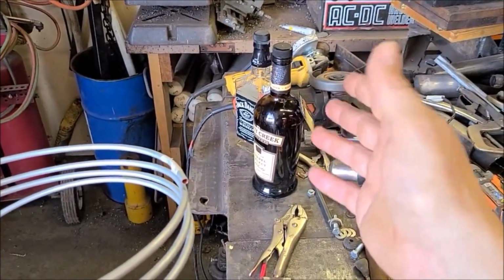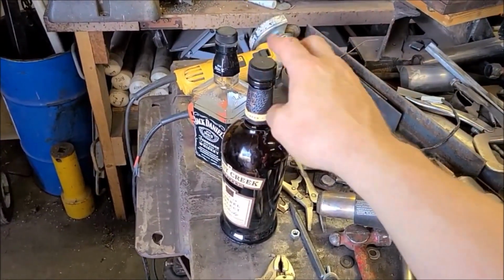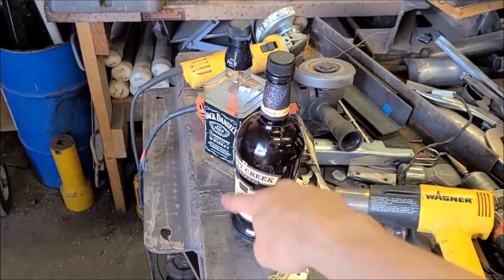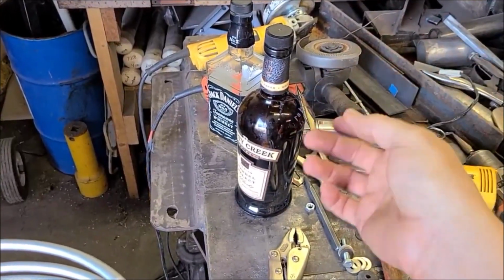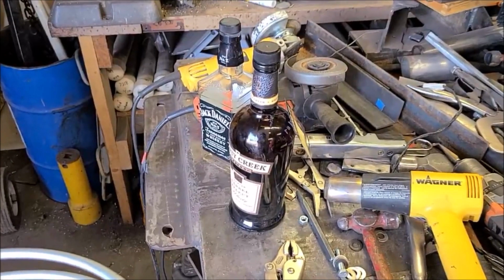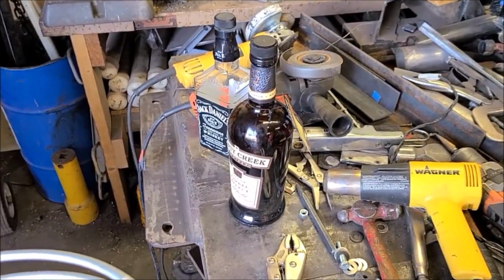I've seen some guys don't vent these, but I don't think that's a good idea. I'm going to put 2 down. One will be the feed from the radiator, and the other one I'll run out to a spot that if it overflows, it can drip on the ground, because I wouldn't want this to overfill and pressurize. You know, I don't feel comfortable with that. It's not rated for that. So just to be on the safe side, I'm going to run it in and out.